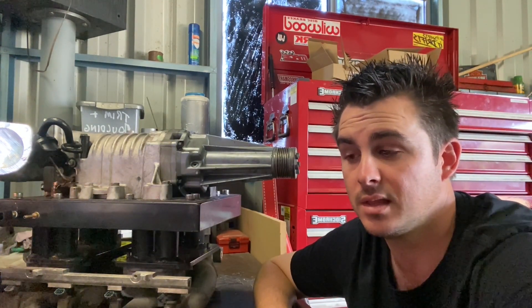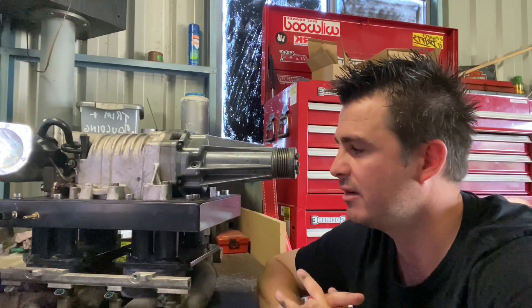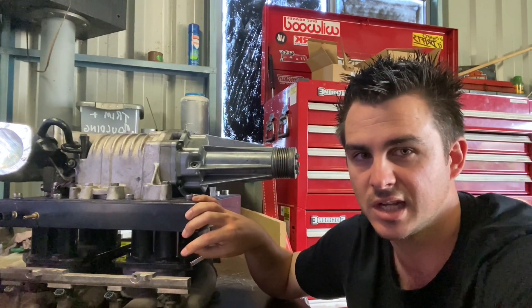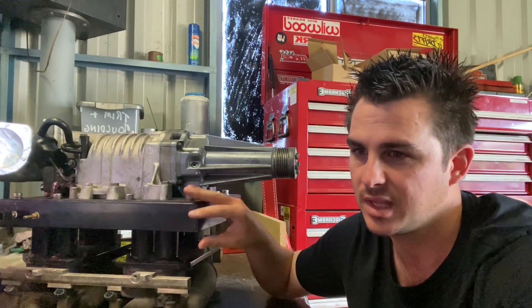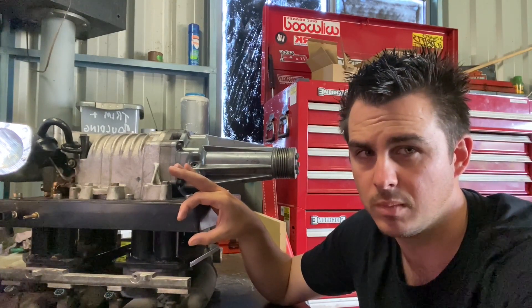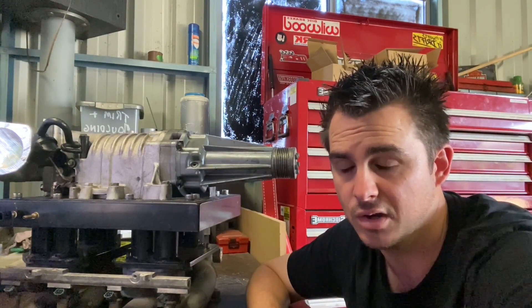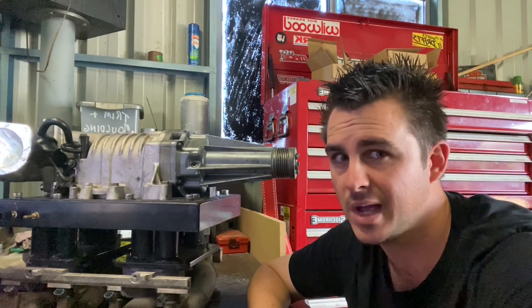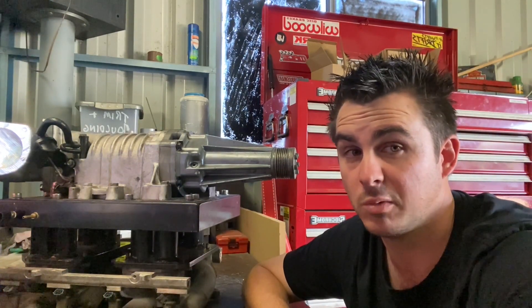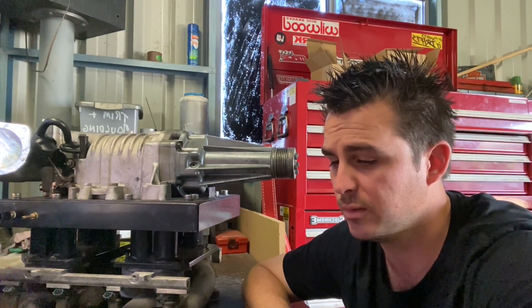The next option was Mace themselves — they make an adapter manifold that is an air-to-air intercooler setup. It basically replaces that section on the Commodore setup: the supercharger blows into a box with a two-and-a-half-inch port that you feed intake piping out to an air-to-air intercooler at the front of the car, which feeds back along into the bottom half of their box and into the heads. Probably works great, but not very appealing to me.